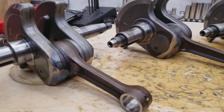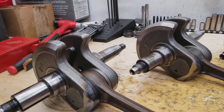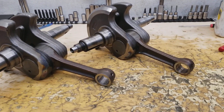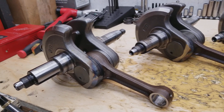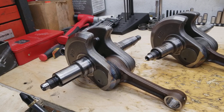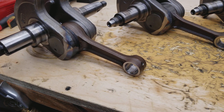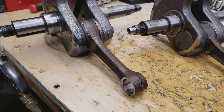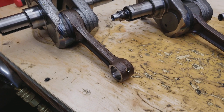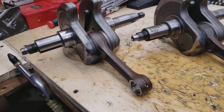For whatever reason, this new rod is about 20 thousandths shorter than the older generation rods. I'm not sure if that's intentional or something in production. The piston that goes with it is substantially taller — a lot more height — but the rod is a little short. You can use the same pistons on this rod and it's not really an issue; they'll just sit a little bit down in the hole.